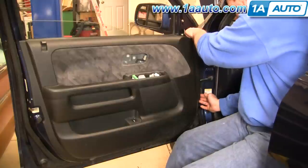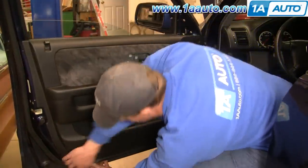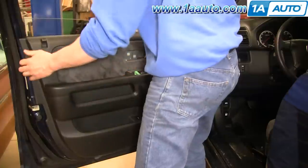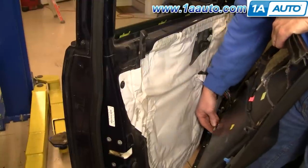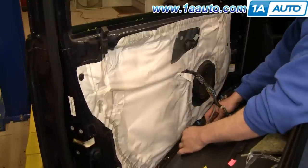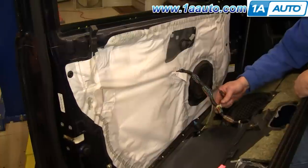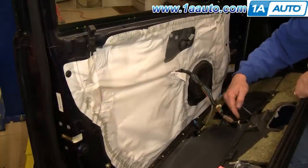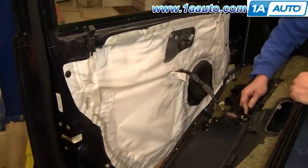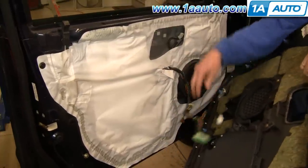There's a series of clips that hold the door panel to the door. Once you have it released, lift up. As you pull the panel away, this is your trunk or hatch release — just push on the brown tab to the side and that disconnects. There are two connectors here. Insert your screwdriver right in here under the tabs, come right under here on this side, pull up and that comes out. The door handle is free.